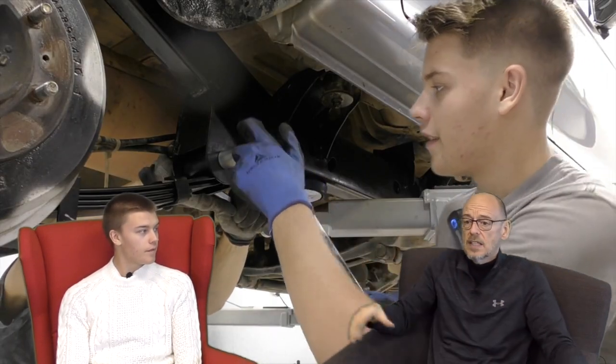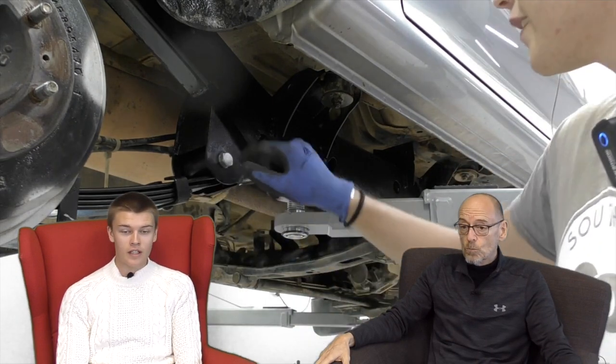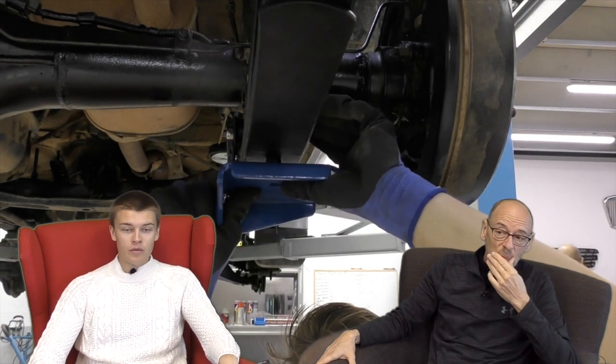As we went through, we like the product called ACF 50, which is an anti-corrosive oil you can use on plastic and rubbers - it just seems to not do any damage to anything, just seems to protect it slightly. If you've got corrosion it will inhibit its progress, and if you haven't got any it'll stop it forming. As we went down we cleaned the whole vehicle underneath - chassis, the lot. We spent hours cleaning and that's why at the end it looked like a different vehicle, almost brand new. We were very chuffed. As we took bits off we cleaned them all in ACF 50 and cleaned around them. We painted the exhaust because that was rusty, and the bar that connects the wheels together. But all the rest was just ACF 50 - that's probably your number one product.